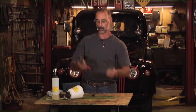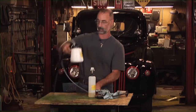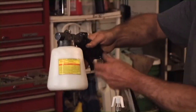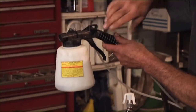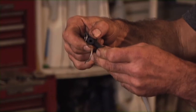This manual system is one option. This next one is a little bit higher tech — it requires compressed air and has a couple of aspects to it. I hook it up to air, and as I squeeze this, my high-pressure air shoots across the top of this chamber. That creates a vacuum which is then going to draw through this line, which is connected up to my bleeder valve.